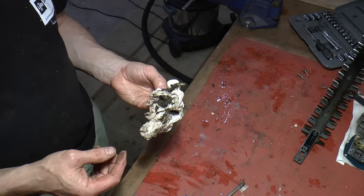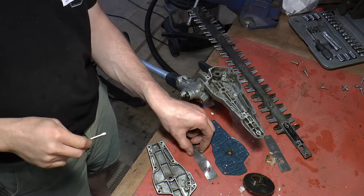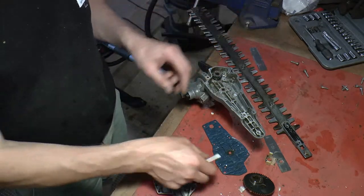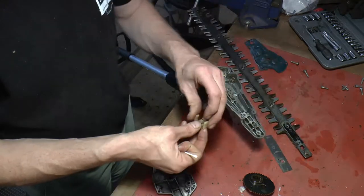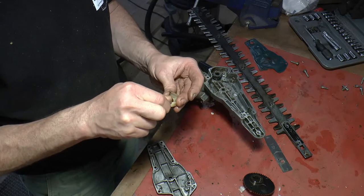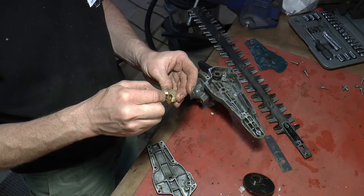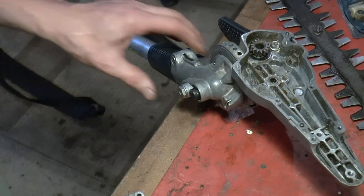I've cleaned up the parts - I'll show you them in their pristine condition in a few moments, and I'll tell you about tricks for getting a part number in the future. These little metal plates clean up really well - put them in a parts washer with some engine degreaser and a rub with fine wire wool. The gasket is in not bad nick - I cleaned it up and it seems fine. The gearbox is a precision instrument, and any particles of grit or metal from the disintegrated bearing would just make it fail prematurely again.